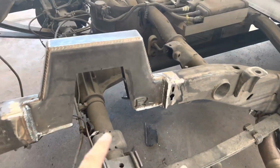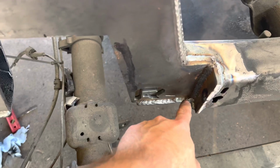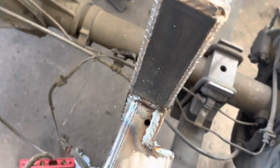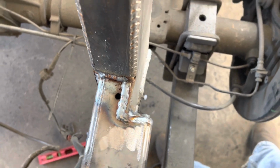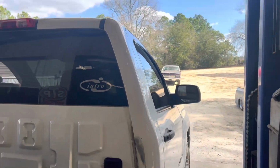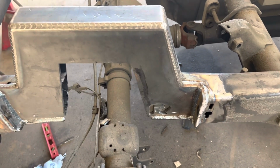All right, so I got the plates welded out, got the bottom trim back right here close to the weld, got both sides welded. You can see how much narrower it makes the frame. I wish somebody made a kit like this for that box Chevy working on right there. In the last video, we made it a lot easier. I got about an hour and a half in this, and I got 2 days in that.